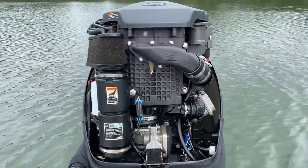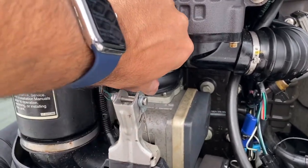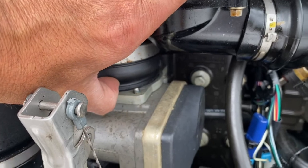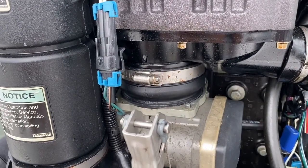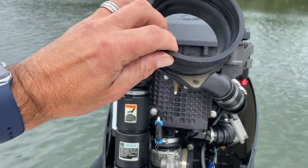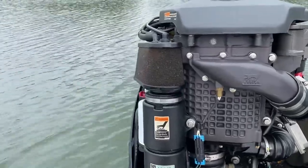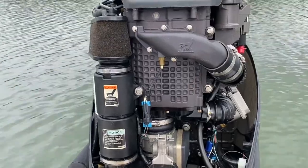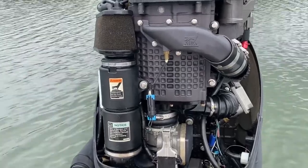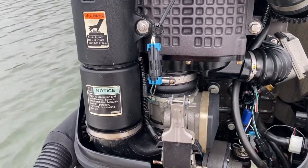There are really two options as to what it possibly can be, and the main culprit is this throttle body isolator right here. This part is pretty old and was obviously reconditioned to a new design. You can see it's basically splitting off of the aluminum base that it's glued to. They've come up with a better design now where the rubber goes all the way around the base so there's no chance of splitting and letting air in. I think what's happening is air is getting in and confusing the sensors within the throttle — making it think there's too much air and that it needs to rev higher. By replacing this part with a couple of clamps removed, I should be able to alleviate the problem.